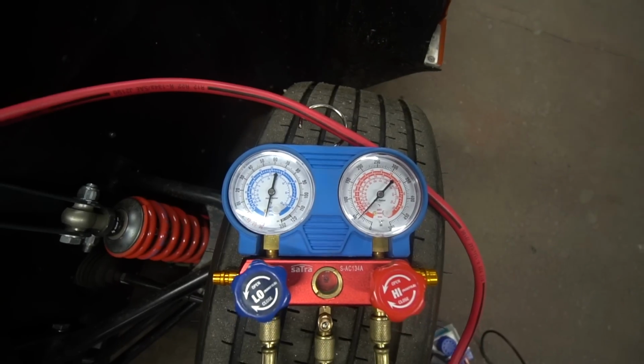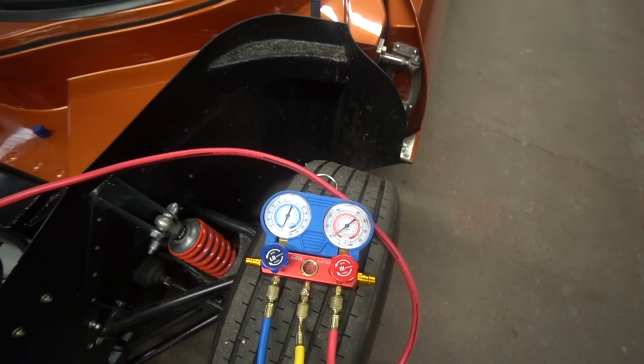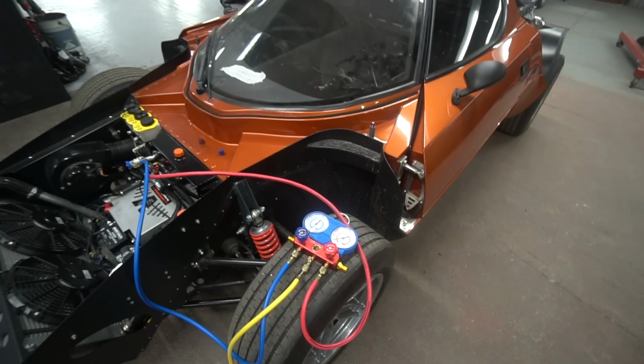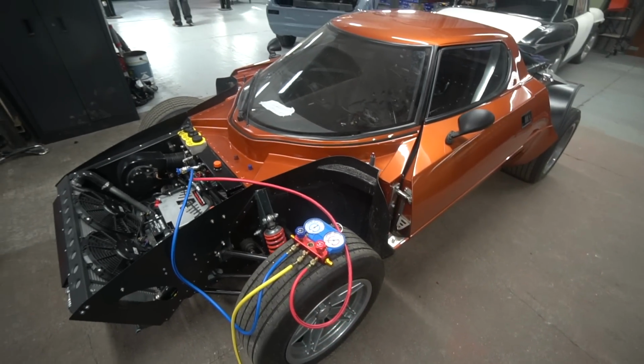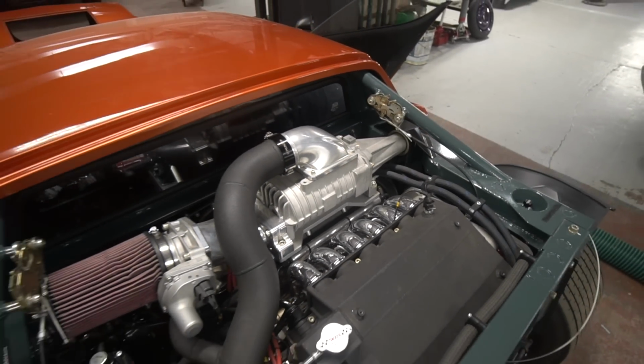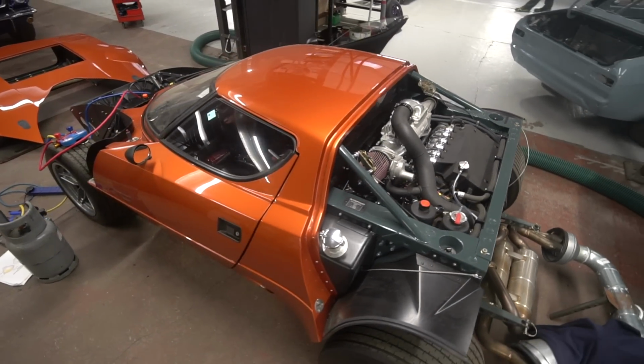Stratos, we gassed up the AC. I think I mentioned last week that Nat had a go at soldering. There was a pinhole in the AC evaporator. He decided to have a go at soldering it, and that did work out. So I was able to gas that up and get that working, which seems fine. Which then allowed a load of other jobs to be done.